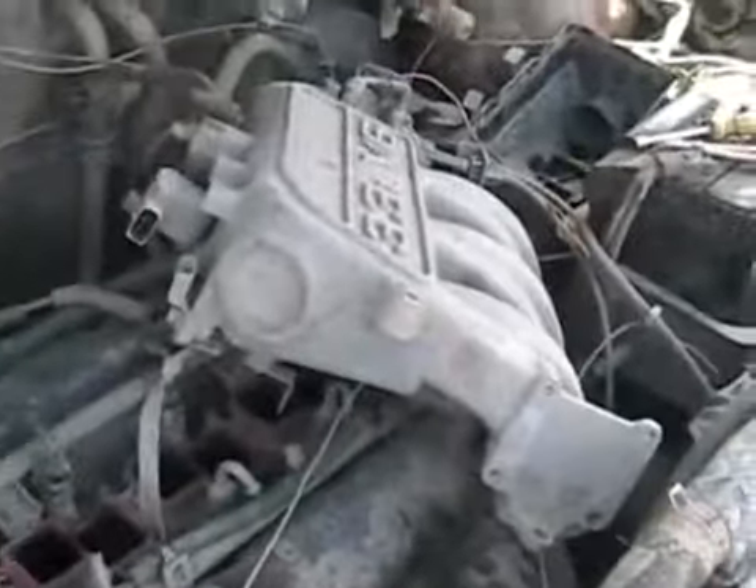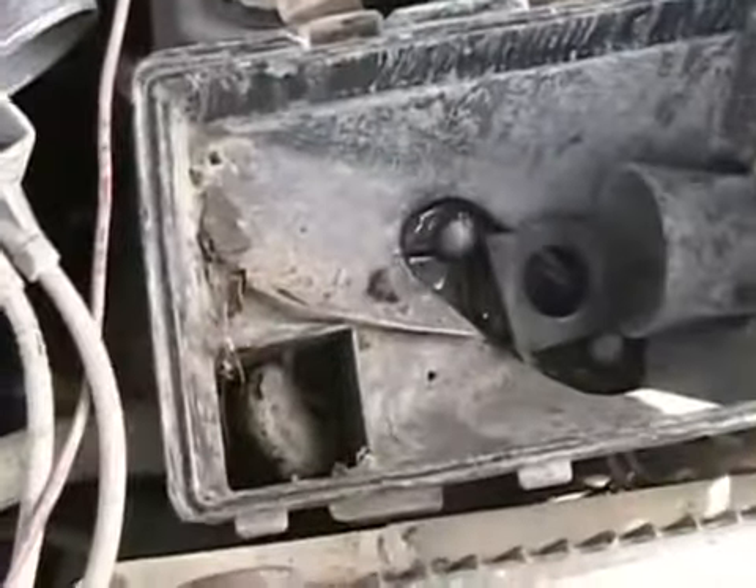We got the intake manifold off — I took that off so that I could tip it and dump out all the water. There's still water drying up out of the air cleaner cover. The way it caught water was right here by the air input near the computer — air comes in through the computer, goes to the air filter, and goes to the intake manifold. I'm drying out my soaking wet air filter at the same time. When I looked down into the intake ports there was lots of water down there. All the spark plugs are pulled out.